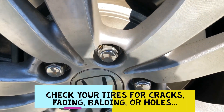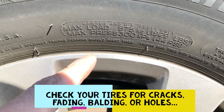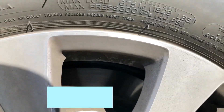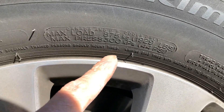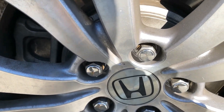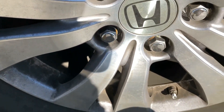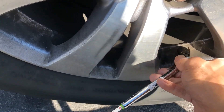Just make sure you double check your tires. It'll tell you in the tire not to go over 40 — in my particular tire it does tell me that. Even tells you the max pressure: 44 PSI. So for this one, you don't want to go over 40 PSI. Don't over-inflate the tire, so keep that in mind when you're pumping air.